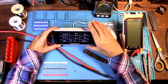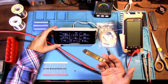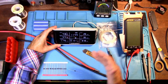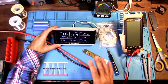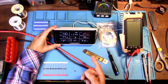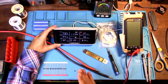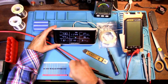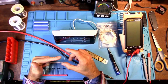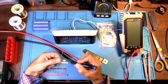And the reason for that is that some of these devices that have polymer batteries in them only allow the voltage to go so high, and then in the board itself it cuts the voltage off. We're going to be testing this live again, but in my testing this is just under 4.2 volts, which would be perfect for 18650. I also found an issue using diodes. When you use a diode, the current flows one way and it will not come back.